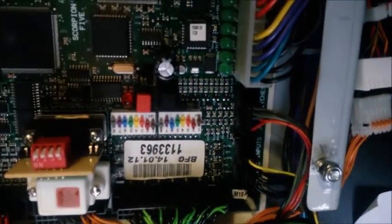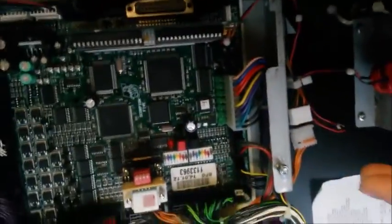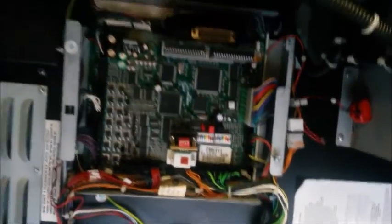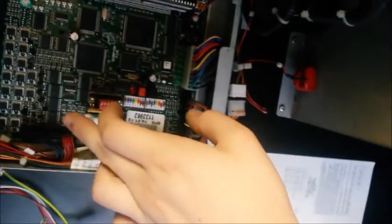Turn everything active. All it does is everything that's in the off position will come on. It won't damage the game. It'll just change some of the parameters. You turn them all on, and if your jackpot's on 35, some 35 games were not programmed to take note readers. Don't know why. Ask the manufacturer. Set your machine to 70 to test this theory. But some machines did not allow note acceptors on £35 cash.